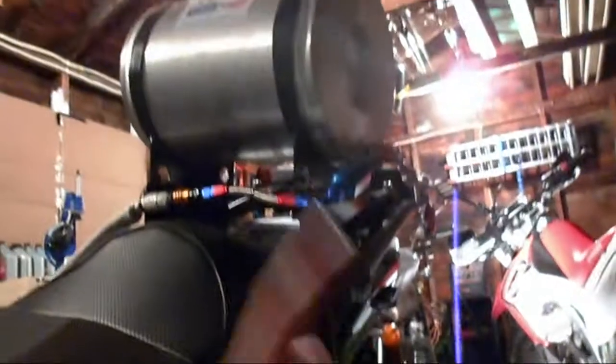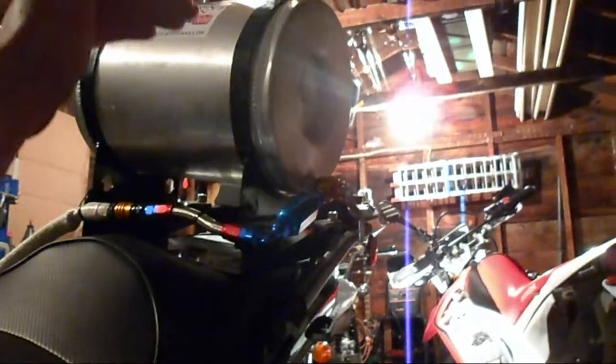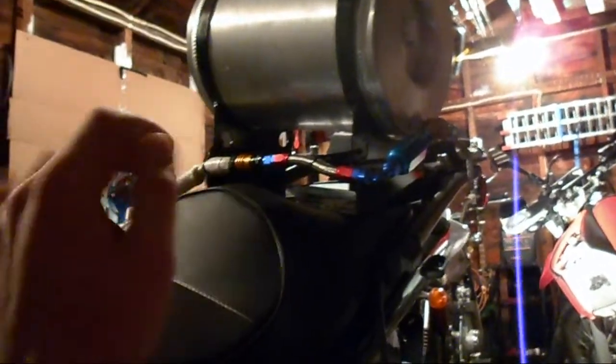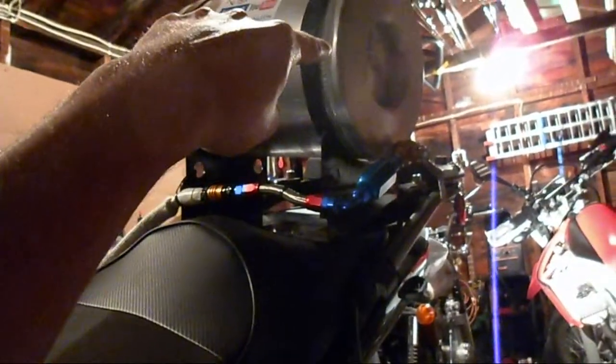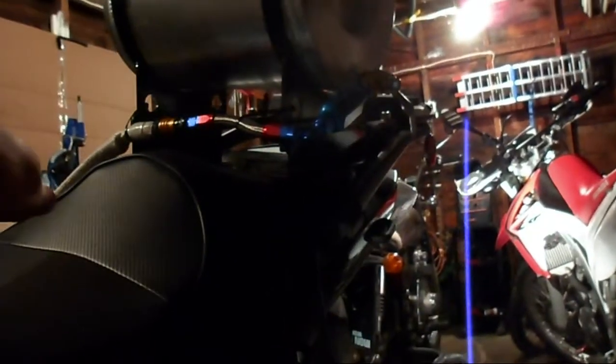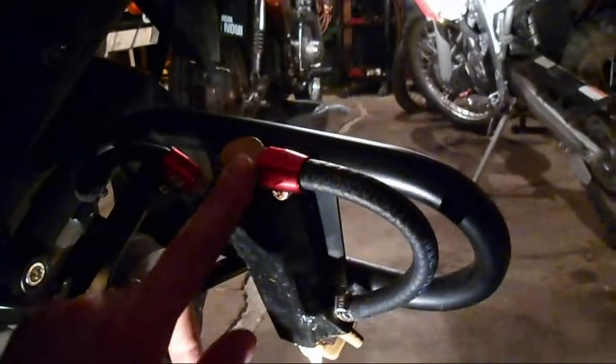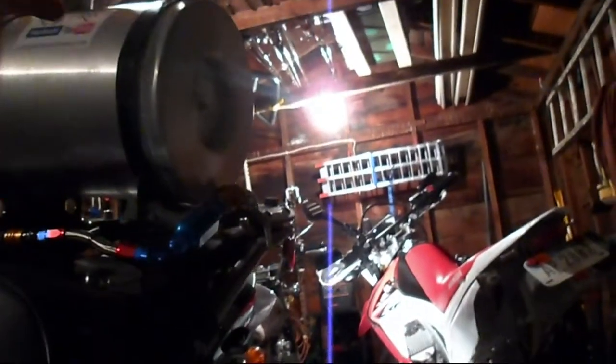When I am draining my auxiliary into my main tank, air needs to go back through here so that air can fill up the auxiliary and gas flows out. Because if this was sealed, what would happen is the main tank would have to burp air into here and then a little slosh of gas would come through, and then it would have to burp some more air — that is inefficient and it probably won't even work. So here I am introducing air through this muffler, which is why it is there so bugs and dirt and other things don't get in. Air comes into here, into the hose, into the main chamber, back up through the hose and into the tank. That makes it drain much faster.